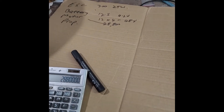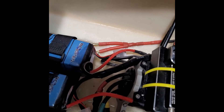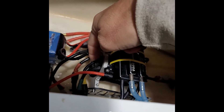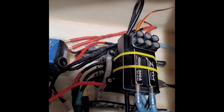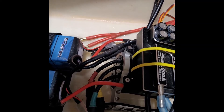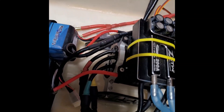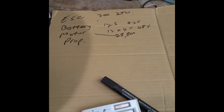When I say check your temperatures, I don't just mean the motor or the speed controller. You want to check your batteries and you want to check the wires between the motor and speed controller, and the ones going to the battery. Make sure you can hold your hand on everything. With the motor itself, make sure you're testing the front and back of the motor with your hands, not just where the cooling jacket is — same with the speed controller. I think the temperature is too hot if you can't put your hand on something and keep holding it. If it's going to burn your fingers after some time, it's definitely on the warm side — probably more than I would like. Some people use a five-second rule, a ten-second rule, or thermometers, but that's just the way I do it.